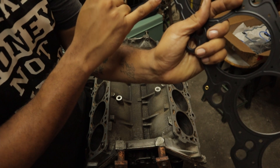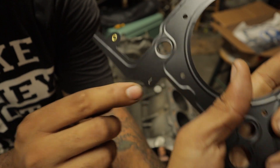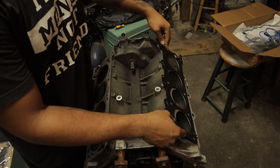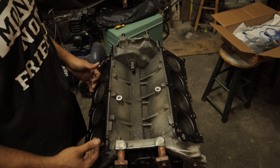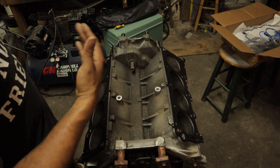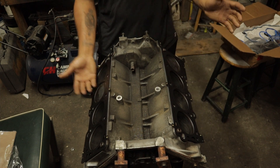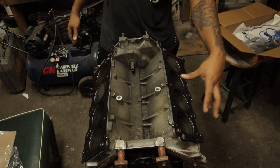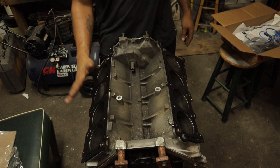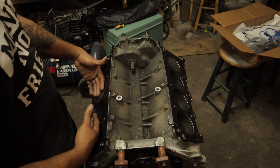This has an L on it, so this is for the left side, and then to indicate the right side they obviously have an R on it. So we have the gaskets set in place now. If you're standing behind the motor or sitting in the vehicle, this would be your left side and this would be the right side. The one that has R on it actually goes on this side if you're standing in front of it — it goes to the left. The one with L goes on the right. They label it as if you were sitting in the car.